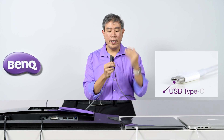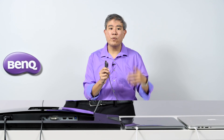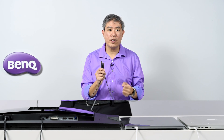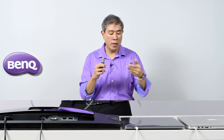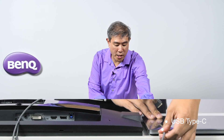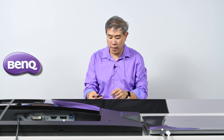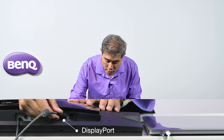I'm avoiding using any kind of adapter that involves HDMI because HDMI has a tendency to compress tonal range or RGB range, and when that happens every time you try to do a hardware calibration on your display it will always fail. So this is a cable I have tried and I guarantee it will work. You plug the USB Type-C end into your laptop — it doesn't matter which USB Type-C port — and on the other end plug the DisplayPort into the DisplayPort connection on your display.